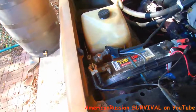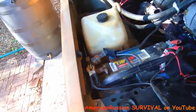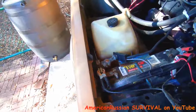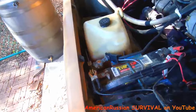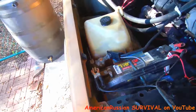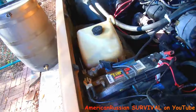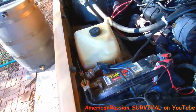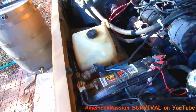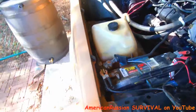But I always found that if you have your battery sitting in a car for, I don't know, several months, and this is why you see at the dealerships, in the used car slots, or any of the classic car lots, they always disconnect the battery, because there's always a parasitic draw. Even if it's not a huge parasitic draw, there could be a clock in there, a computer, something. Even if there's no dome light on or trunk light, there's always some kind of parasitic draw.